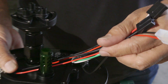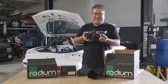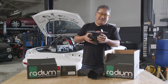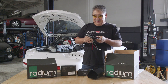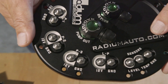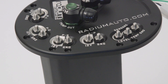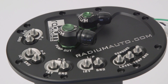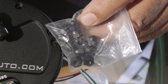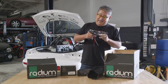All your wiring inside the tank is better than OEM grade with Teflon insulation — totally impervious to gasoline or any exotic fuel. If you want to run E85, methanol, or whatever, it's not going to mess these up, so you don't have to worry about any electrical issues. The same thing with the terminals — it uses stainless terminals to pass through the plate, totally serviceable and sealed against all exotic fuels. You can use ring terminals for your power and grounds, giving a totally solid, really low resistance, super clean electrical connection. There are nylon acorn nuts that go on top of these as well to prevent any kind of short circuiting.